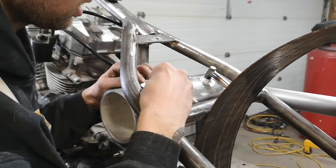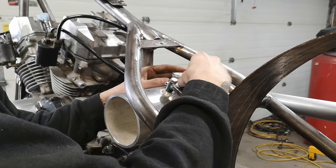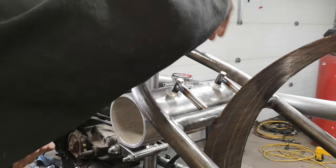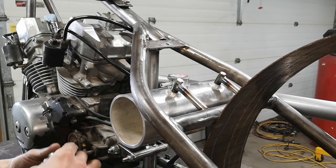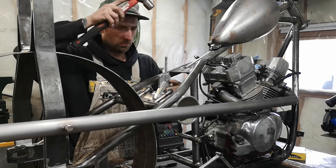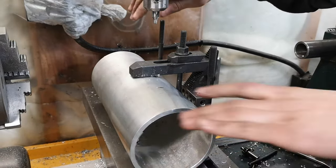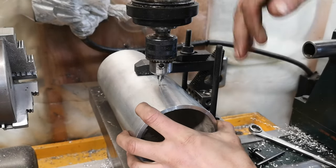I originally was going to put this over here so I could have access to it because of the seat, but it's kind of tight in there. I think I'm just going to lay it dead center up top — maybe favor this way a little bit so I can route that overflow down here. I'm going to put the outlet on this side and the inlets on this side — that'll allow the coolant to flow from one end to the other. You don't want it to just dump straight in and out; you want it to stay in there as long as possible. Now that this is up here, I can figure out where all my fittings need to go.